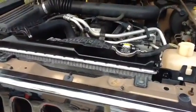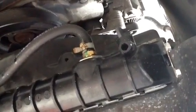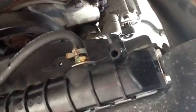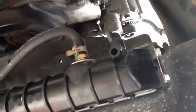Now we'll go underneath the car and take a look at the connections there. Okay, we're underneath the car again. That's a familiar sight you've seen before, looking up at the drain for the radiator. The new radiator comes with that drain closed. You may want to just make sure. You'll find out as soon as you start adding radiator fluid and antifreeze.